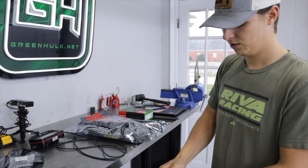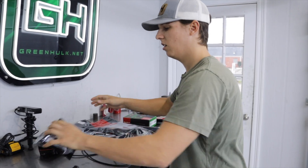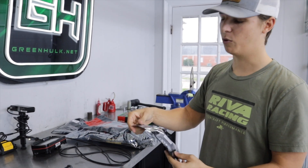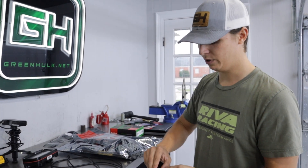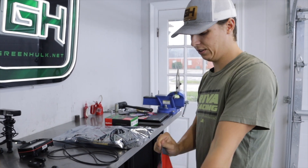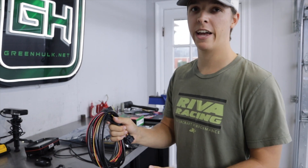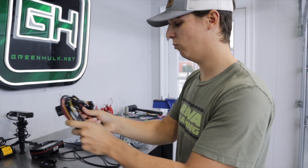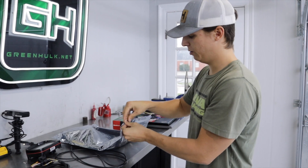This would be the O2 sensor for the wideband O2. You do need an ignition module to power the OEM coils. I opted for the OEM style Bosch ignition module, but if you like you can upgrade that to the FuelTech one. This is really all you need. This would be the wideband O2 harness, which is going to allow us to monitor AFR and log it through the FT-550 with closed loop fueling capabilities. And this one here will be the main harness.